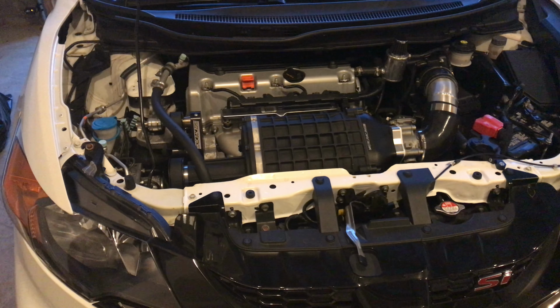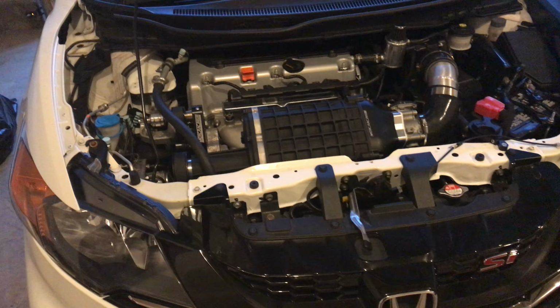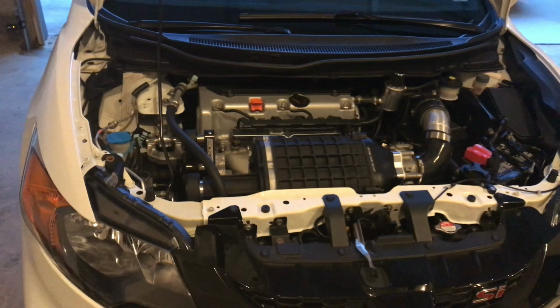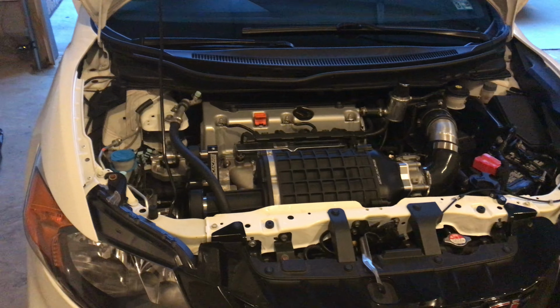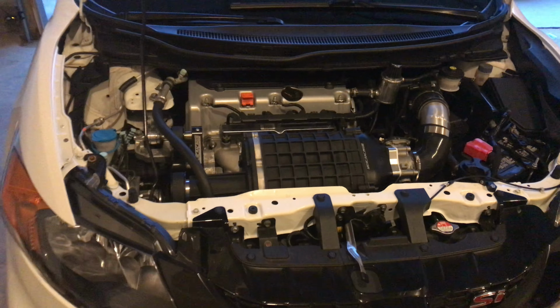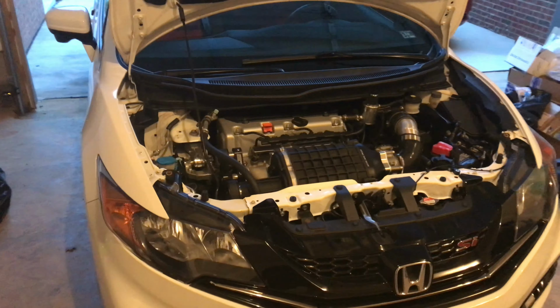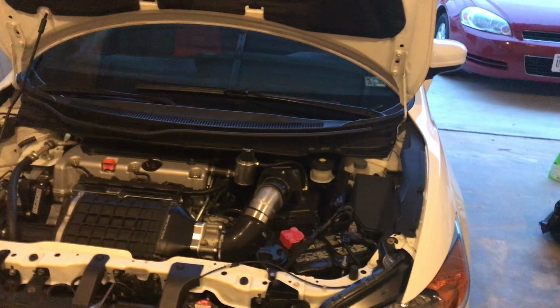And like I said, with the OEM clutch on the Kraftworks, it works well enough because you get no down low torque. Everything's top end, and I guess it's able to hold it. I have no idea, but with this OEM clutch, I was pushing, I think at pre-VTEC, my tuner was saying at like 3,500 RPM, we were pushing 290 wheel torque. And you know, the clutch couldn't hold onto it, so. But like I said, I'll have another video explaining everything. This is just a quick overview of my car, and stay tuned.